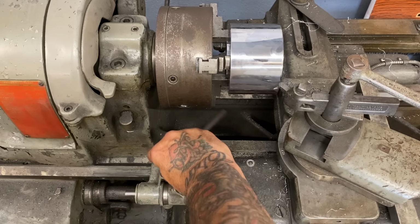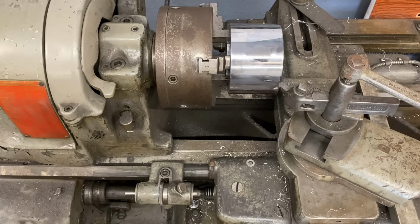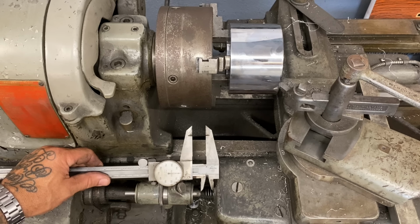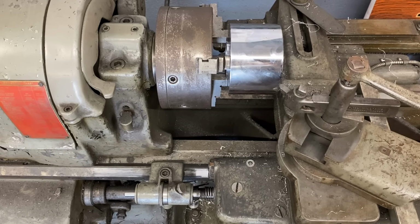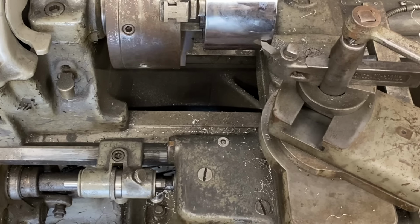Now I know I'm cutting exactly 0.08 of an inch off of the part. A CNC machine will do this by computer calculation. I go ahead and do it using a vernier caliper and some good old analog thinking. As I pull my tool back away from the part, my carriage has the range to roll 0.08 of an inch down.